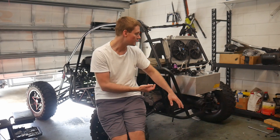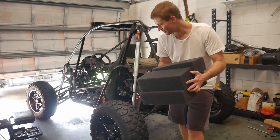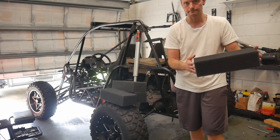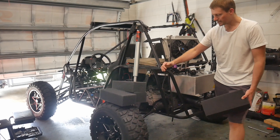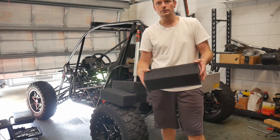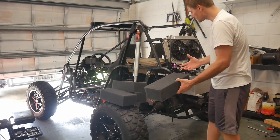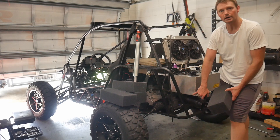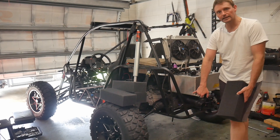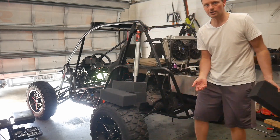A couple of you guys reminded me during the last safety video when I rebuilt the fuel cell about the importance of foam that goes into the tank. There are a couple of reasons why it's a very good idea to use it. Number one, it helps prevent fuel sloshing from side to side, so I'll get better traction and won't have weight sending the back end of the buggy in crazy directions. Also — and this is one of the biggest reasons — the foam will actually slow the propagation of any combustible fumes. If something got ignited, or a puncture in the bottom of the tank starts dripping fuel, it would in theory prevent that flame front from propagating into the tank and causing an explosion.